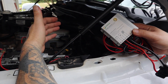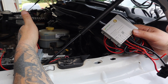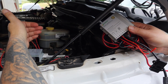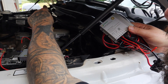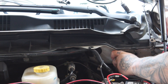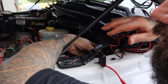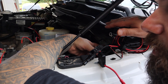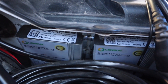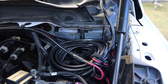Being that there are two solar chargers, I'm going to split it between the two batteries — 70 watts to the house/accessory battery and 80 watts to the starter battery — so I'm charging both while the truck is off. I'm mounting both charge controllers on the firewall side by side. I want them permanently mounted since I'm off-road quite a bit. The wiring harness is run around the firewall, tucked up high away from the motor so nothing can get burned.